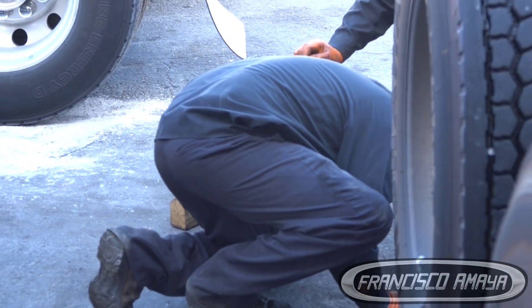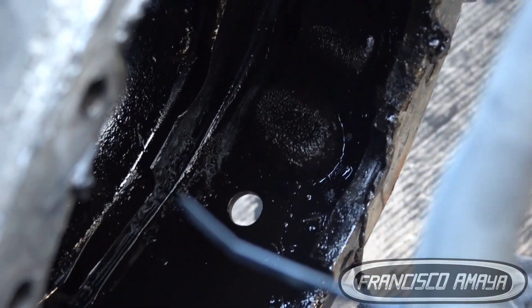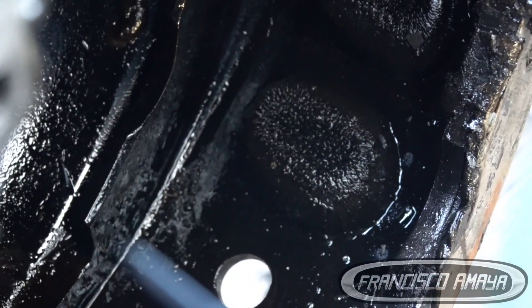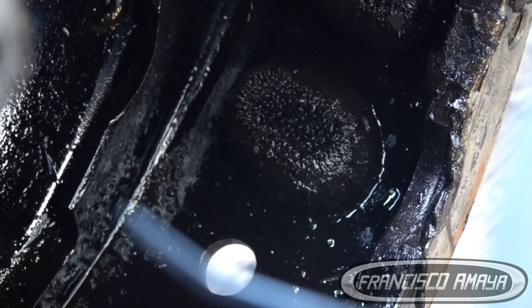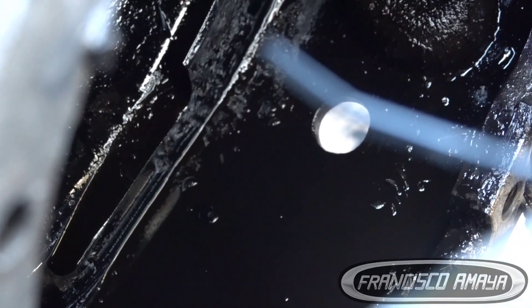At this moment they're looking at everything here. What happened is the differential ran out of oil and you can see all the debris right there. That is metal — because it was grinding with no lubrication. You can see the oil around it is kind of like grease because it got burned completely, and of course the differential is no longer functional.